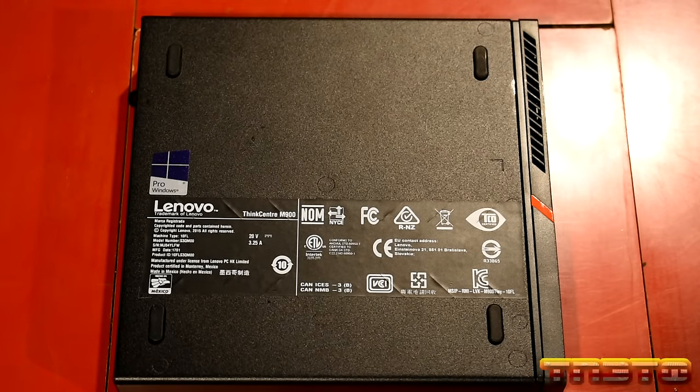I also noticed when I was installing the RAM, when I was looking back at the video feed, the bottom DIMM module didn't look like it was fully seated on one of the ends. Like you could still see a little bit of the gold contacts. I mean, it's obviously fine because it sees both the RAM and the RAM passed, but just for completion's sake, I will go back and reseat that bottom module.